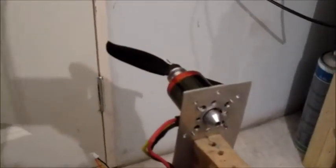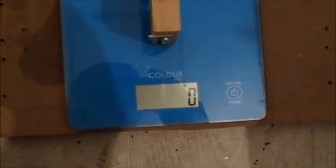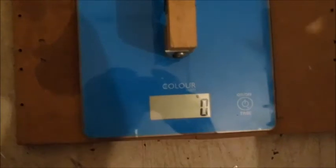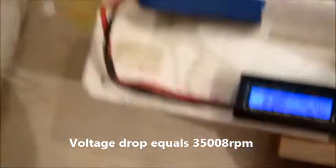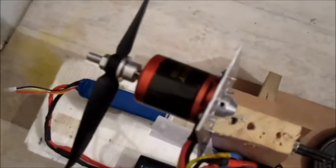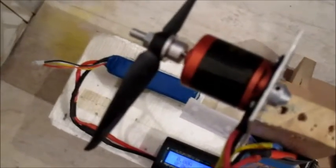I'll top the battery up a bit. Same setup but this is a 4.75 x 4.75 TGS prop — let's see what we get. So that was less thrust on the bigger prop. The smaller prop gave more thrust because it's overloading. Blimey, 53 amps! It's amazing because that's the prop I used when I ran it on the Delta Wasp. I don't think I'll be going any higher on prop size — I think it was best with the 4.5 x 4.5 prop.